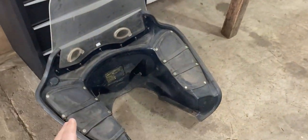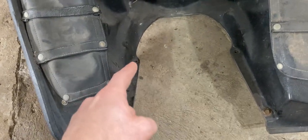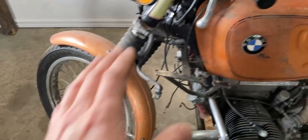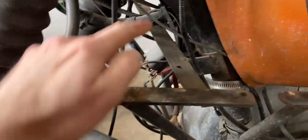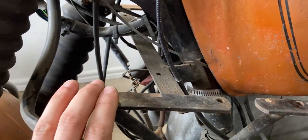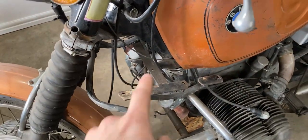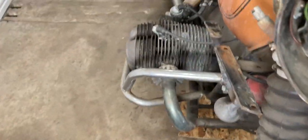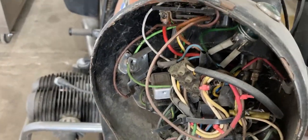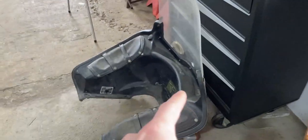Now on to the left I still have the front fairing and it's on the ground. I thought there were six bolts around the perimeter but there were actually only four — two on the left and two on the right. Then we had a nine-pin connector on the left of the fairing. On the motorbike we still have a bracket which mounts to the frame. I guess they just attach it with these hose clamps right here — that worked, but I will be removing this later on. I won't remove it right now because there are a whole bunch of cables right here. This bracket goes off to the right side as well. All the wiring is in the dash as you guys may see.